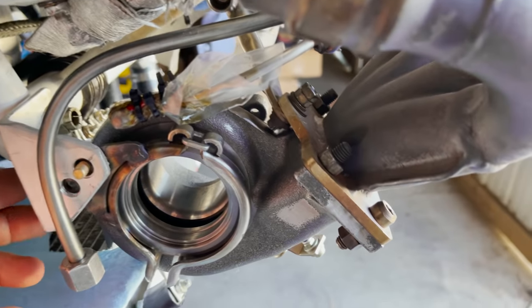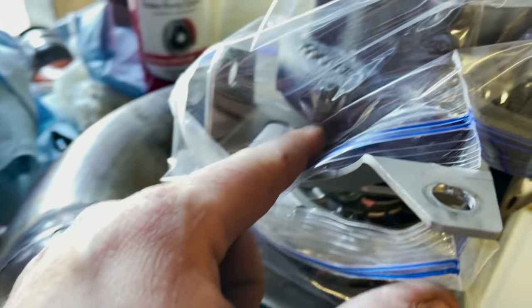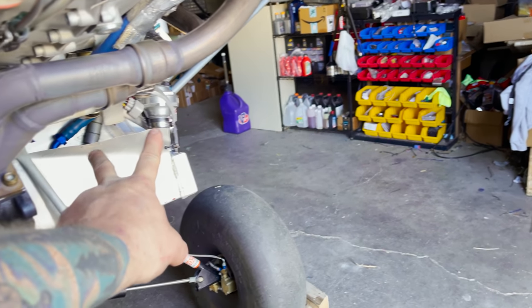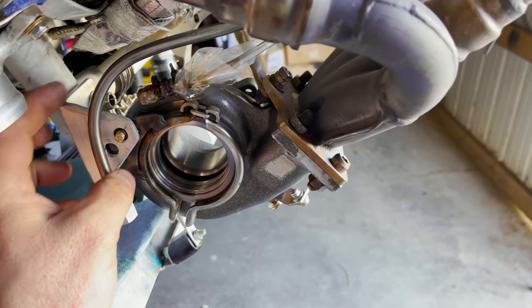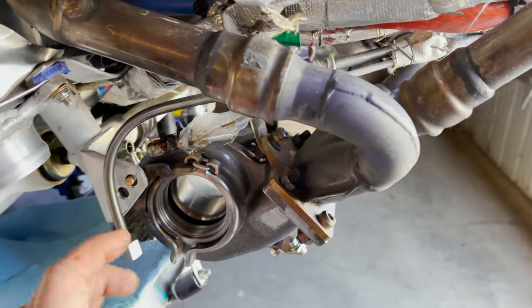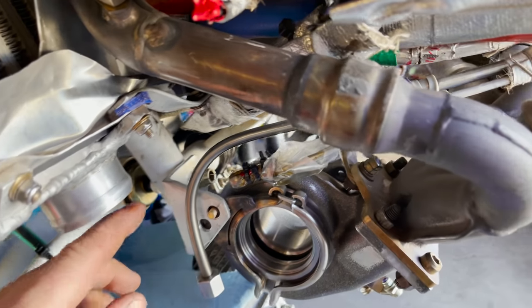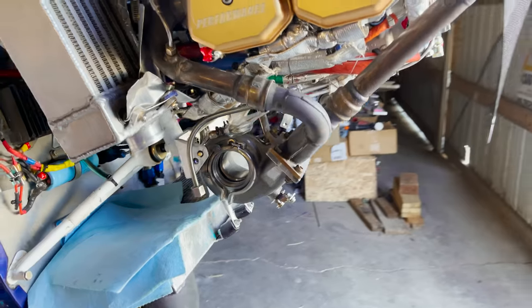So here I'm adapting stuff on. I had to make a bracket because this turbo uses a V-band to hold the center section on instead of a four-bolt deal like the old one. There's this plate right here — this bracket actually bolts on where the bolts hold the exhaust housing on. That gives a nice solid bracket. I still have two good hardy mounts over here holding the dump pipe, but I wanted one more. So I built this bracket off the engine mounts, pretty heavy duty, TIG'd on a stainless piece on the V-band.